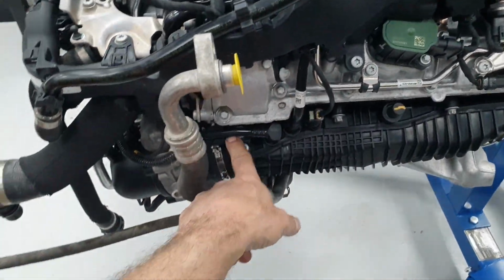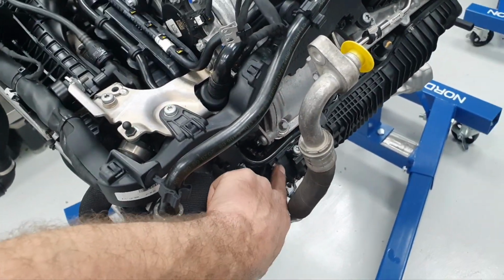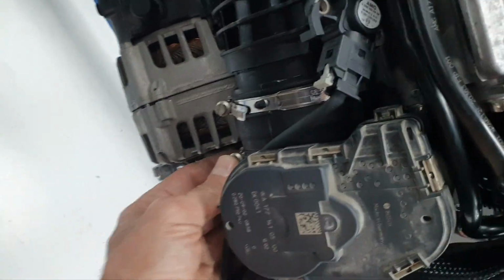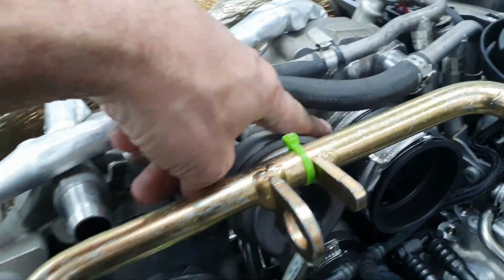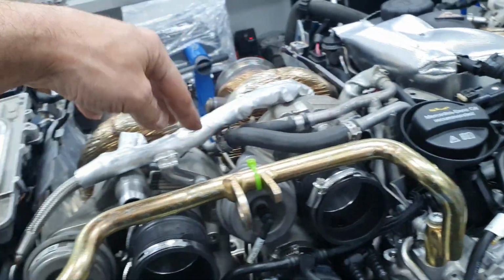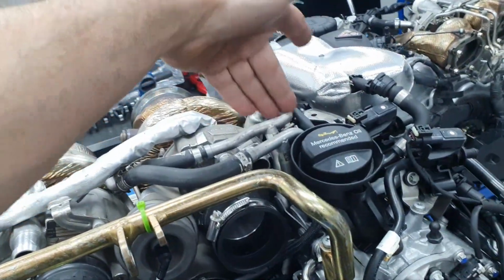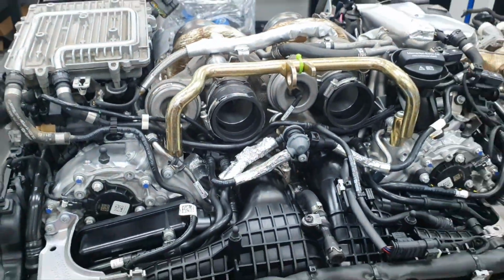The same thing also from this side. Intake air temperature sensor, map sensor, then there is another map sensor here, there is one before and one after. I have already torqued down the clamps for the hoses. Same thing also from here. Alright, same thing here. Alright, and same thing here and here. The oil pressure or the oil feed, the coolant lines, all these things, I have changed the O-rings, I have stainless steel pipes, the pipes are okay, it's fine, nothing wrong with that.